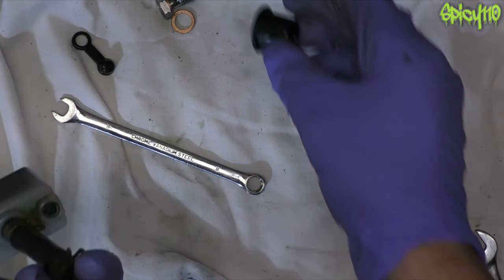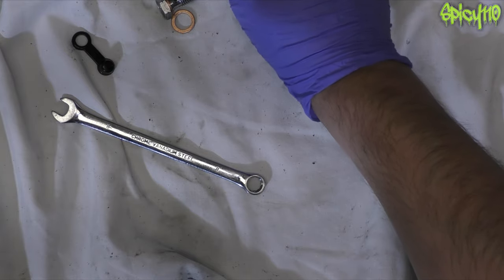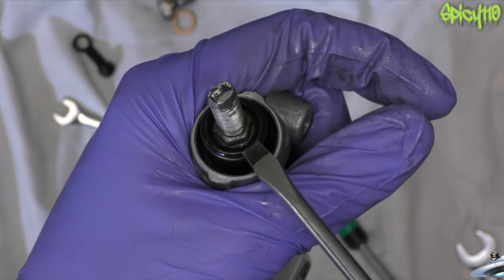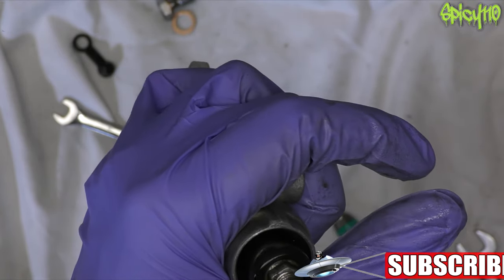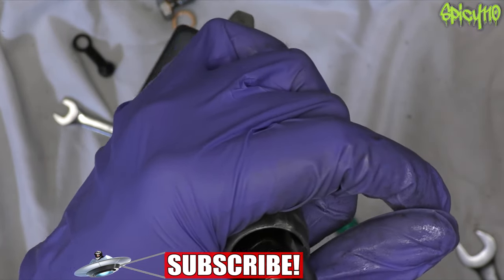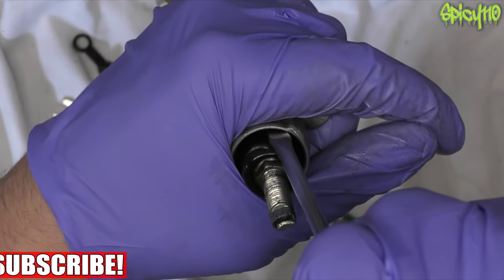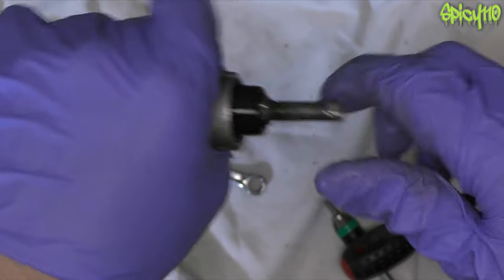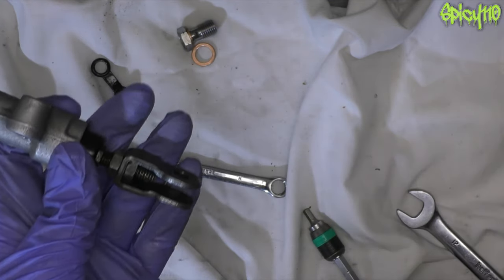So then we take our new little rubber boot, and I will actually use a little bit of brake fluid again to help get this over. So you shove it in the hole and you've just got to get that nut through the top bit. And then gently, maybe use something wooden — just tamp it down all the way around. It's only a dust seal, it's not holding any fluid. There we go. Trying to remember exactly where it was before, but that's within a tenth of a millimeter — that's fine.